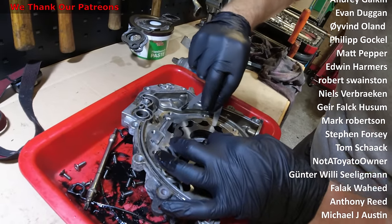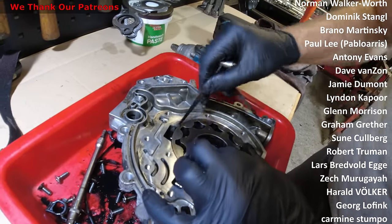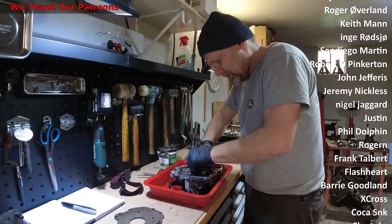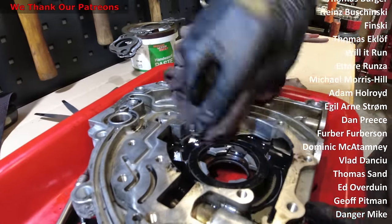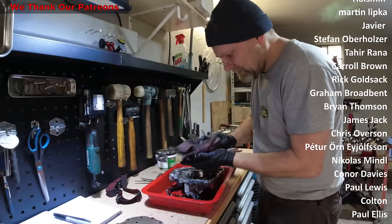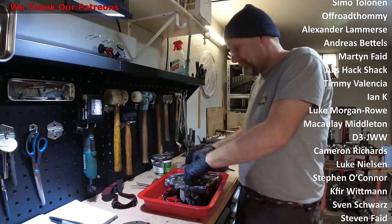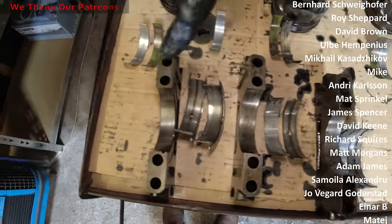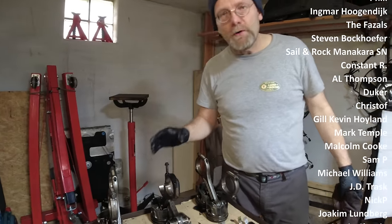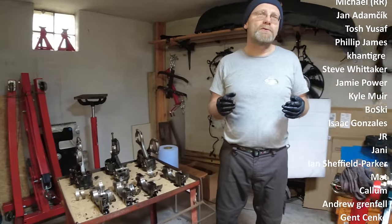There's one oil squirter missing - that's going to be more expensive than planned. First oil change registered at 90,000 kilometers. The oil pump: no severe scratches, just tiny amounts - 0.05 and 0.1 millimeter clearance. 0.1 is borderline loose. The pump may be a problem since the car did not have enough oil changes. When you don't change your oil, everything in the pump wears. There are some scratches on the inside, so it did take some chips through.